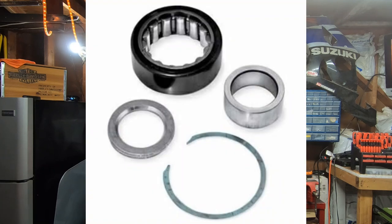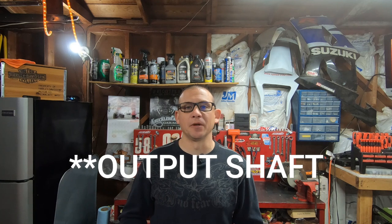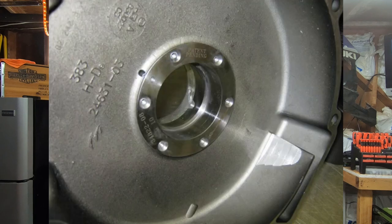If you're looking to put some power into the bike, with the Screamin' Eagle kits there is a required part called the Screamin' Eagle lefty bearing. It has more needle bearings inside to better support the pinion shaft and help reduce wobble when you start putting real power in. For 2003 and newer, there is also a sleeve available that lets you install a Timken tapered roller bearing, which is probably the best option if you're not replacing the crankshaft, as it gives the crank better support and helps reduce wobble.